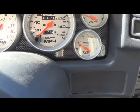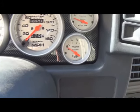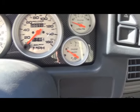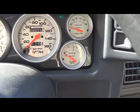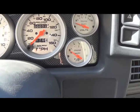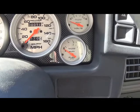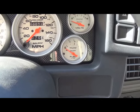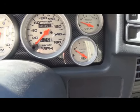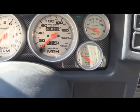On this combination, we pumped the gas one time and let it ride off — you can see it idled right away. We didn't have to put our foot on the gas pedal. I took it off fast idle when I just tapped the gas pedal, and naturally it came off the fast idle cam and came down to idle. It idled a little rough, so that might have been a little quick to do that, but those are things you can tailor to your own vehicle — how fast you want it to idle and when you're going to tap it to come off. It is capable of starting right up, idling, and functioning properly.